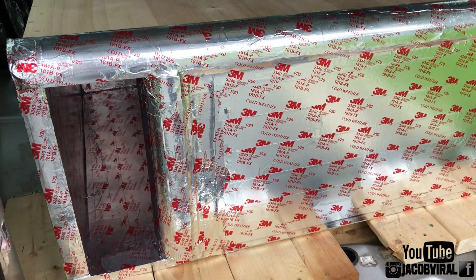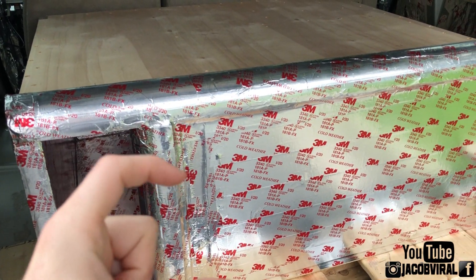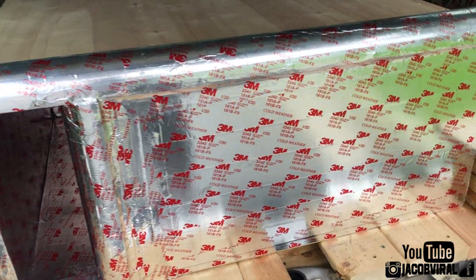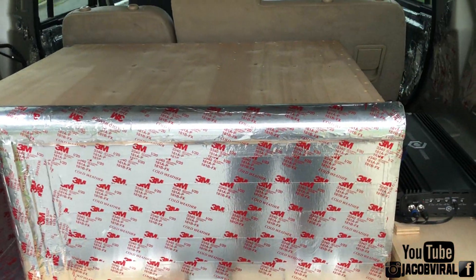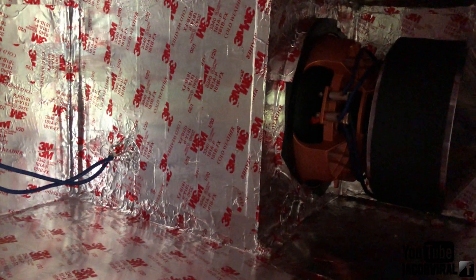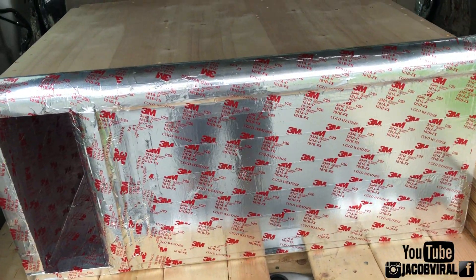I'm going to have a little more cone control and cone pressure, and a better coil size — potentially going into a four inch coil instead of a two-and-a-half to three inch coil like with 10s. My power rating will be able to handle more: instead of handling 2kW RMS max with the 10, maybe 2,500W, I'll be able to go into a five to seven kilowatt RMS system. I can gain output with more power handling per subwoofer while staying single sub. I'll be making a video for suggestions on the 12 inch choice.